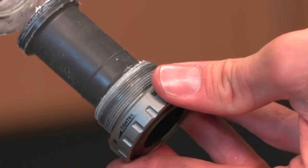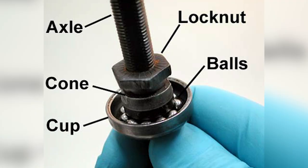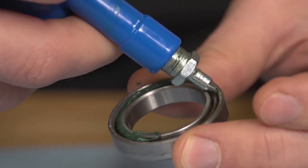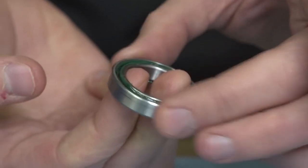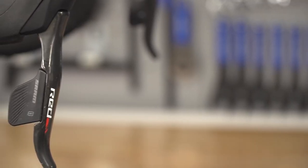But where are we actually going to use grease on a bike? The way I like to think of it is things which don't get taken apart that often. So things like your bottom bracket threads if you've got a threaded bottom bracket, and all of your bearings — particularly cup and cone. With cartridge bearings it's not that practical to go in and grease them, but you could still layer grease around them.